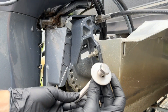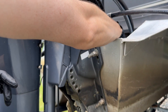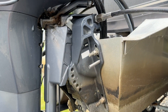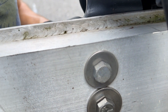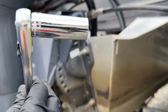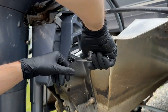The transom on my boat is fabricated with rectangular aluminum tube, which means I have to drill through two sides of the tube before I get to the other side. Typically when drilling through two sides of something, I would measure and mark both sides and drill two separate holes rather than blasting through both layers from one side. The transom is a somewhat irregular shape, so I decided drilling through one side would probably give me the best chance of getting a reasonably straight hole. The washer fits just below the existing one — if that wasn't the case I would have just ground down the new washer a little bit to make room. No need though, because everything looks great.